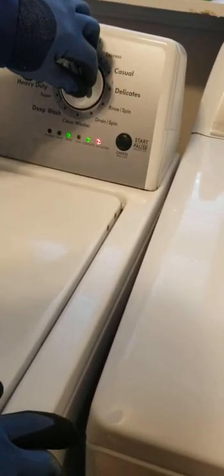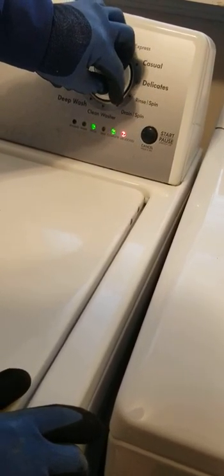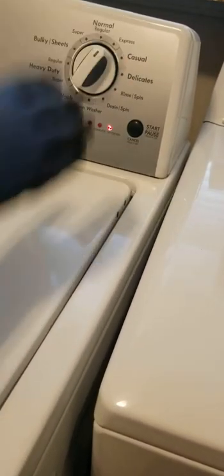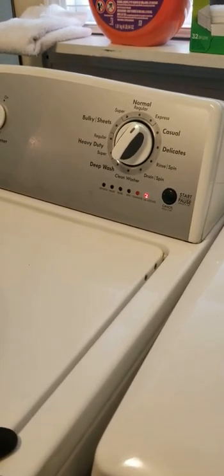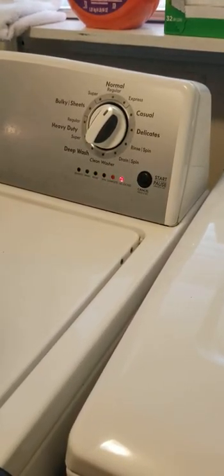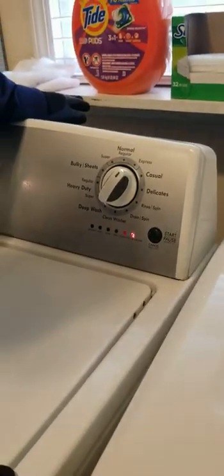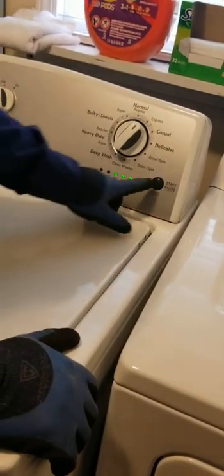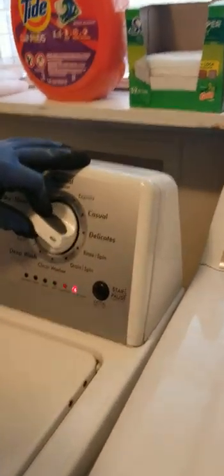Letting that run, we're checking for a leak just to make sure our seal did good. We don't see any water coming out. Inside the port it's too heavy — we actually weaned it back just a little bit, looked underneath, and things have been looking good. Don't leave it back too far with the water sprayer. If you get too much water it'll land on the tub and maybe splatter off and make you think you've got a leak. You want to do it while the water's relatively low. You can even go back to the valves and turn the water off, then let it just agitate — or turn the agitate off and go underneath and check. The main thing is you don't want to splash water off the inside and chase down a leak you don't really have.